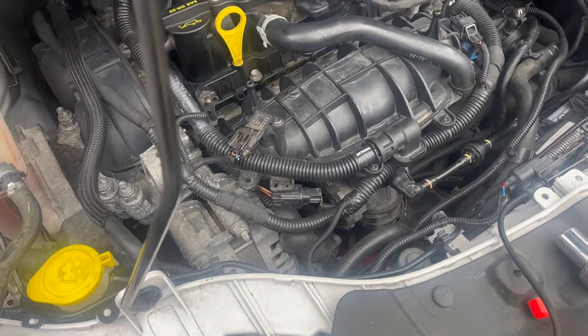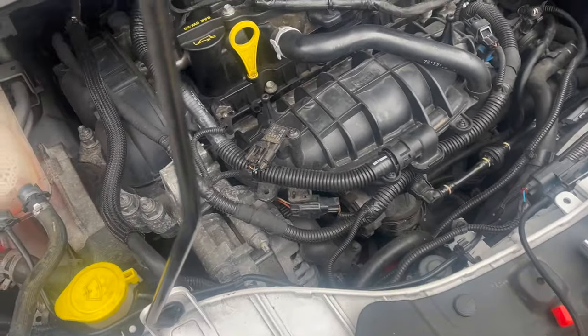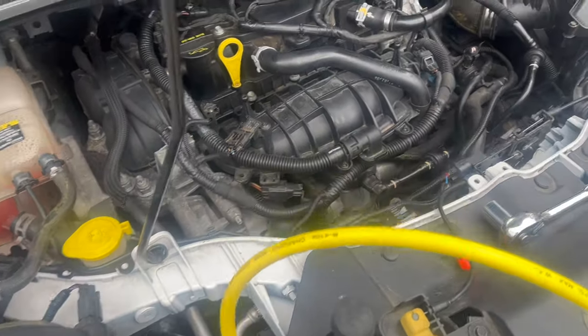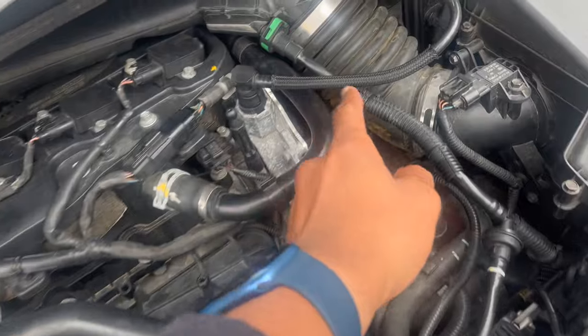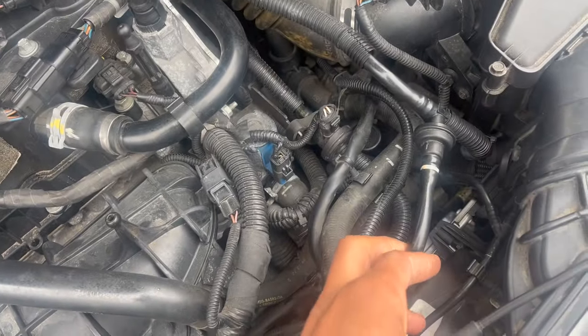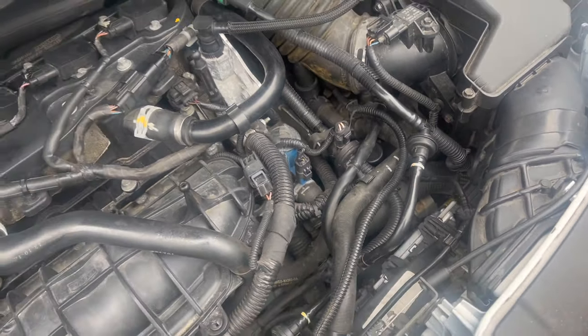So this car used 24 ounces. I have some freon with the dye in it. That's the one that I bought. So, and we have the same issue that I was talking about, about this line with this sensor, that each time you put gas in it, it has a problem. So I'm also going to remove that too and put the new one on.